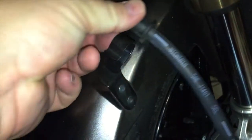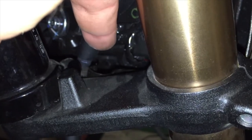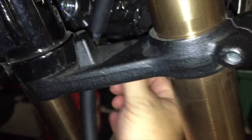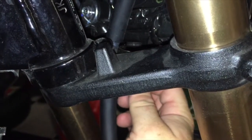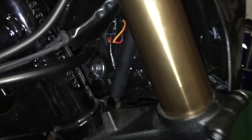Alright, so there's two grommets. There's one grommet here, which is held by this bad boy. And then there's one behind the lower part of the triple tree. It's back here, just trust me. So a technique that I just used to get it out: I tried pushing it, but I bent it. I just tried pushing it that way, really aggressively. That was not a good idea. So what I did is I reached underneath with this hand, and I get to it right here, and I did the top with my left hand. Obviously I can't do it because I'm holding the camera. I basically just spun the grommet out. If you grab the bottom of it and grab the top of it and spin it out in this direction, if you're looking from above, it's a counterclockwise direction. Spin that bad boy out and you're able to get it out. Otherwise you'll just push and bend. So that'll get it out. I'll pull him down from the top and we are golden.